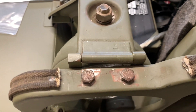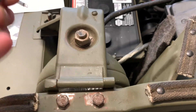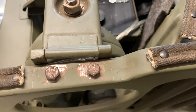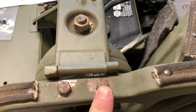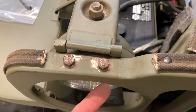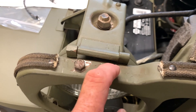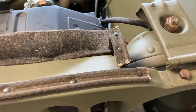We're going to be installing the ground straps onto those two bolts, so I'm going to put them back to the underneath side. Here's a picture of the ground strap — it's a black wire with three markers and connectors on each end. At the GPW, the bolt would come up from the bottom and the nut would be on top, so there's another variation we can discuss in the future as well.